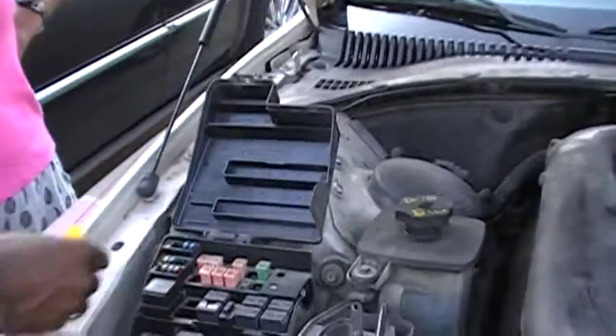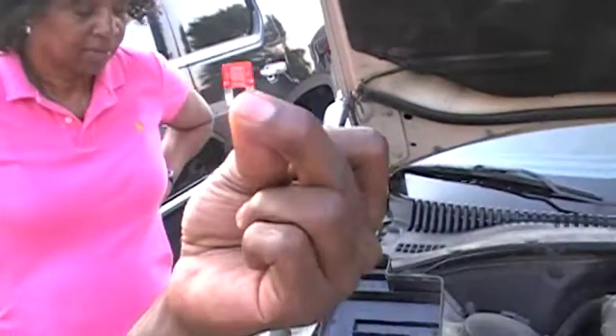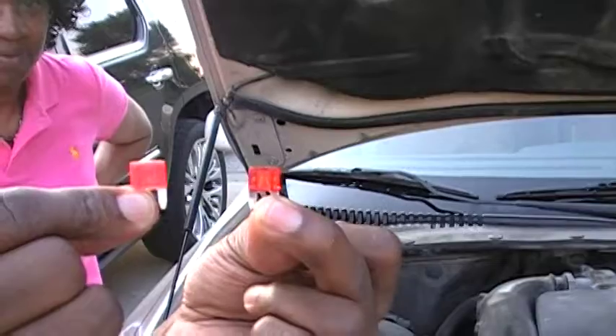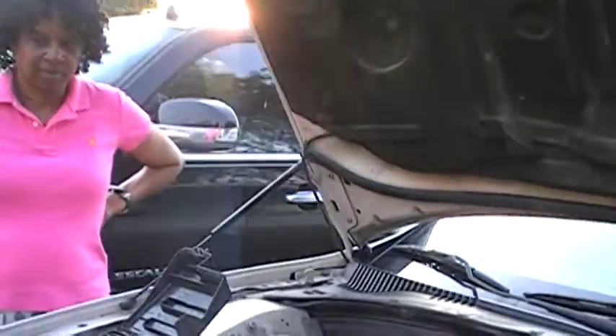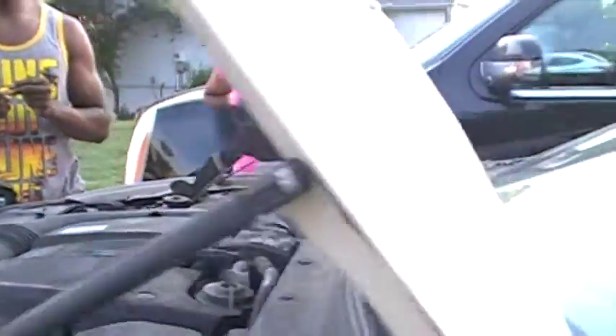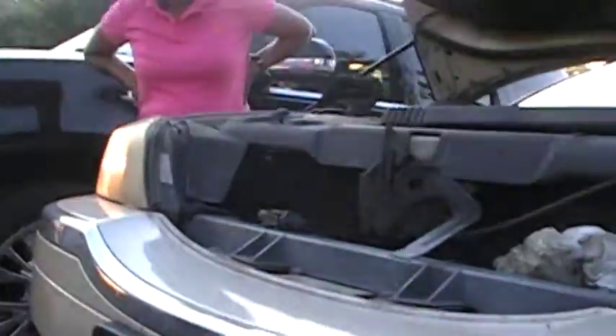All right, back now. We got the right fuse — number 10. This is the old fuse, blown. This is the new fuse, not blown. So you want to start the car? Keys are probably already in the ignition. Go ahead and start it up. We're gonna listen for the click, listen for that sound. Point the camera at the compressor, at the clutch — listen for the click and watch for the movement.